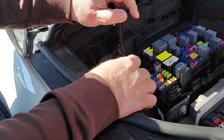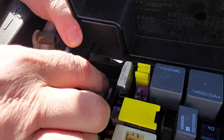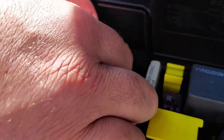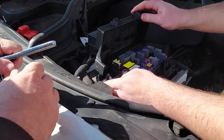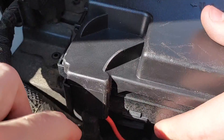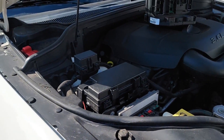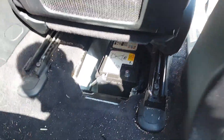And then we'll go ahead and reconnect the positive. See the red one on top? Okay. So this should be bent forward a little maybe? Yeah, I think that's what happened — I did the same thing last time. So you can go ahead and then close the lid. Make sure your wire fits under this little piece here so you're not pinching that anywhere. And ba-boom! New TIPM in the car. Let's see if it works. So make sure to reconnect your battery, otherwise things won't work. Again, that's behind the passenger seat.